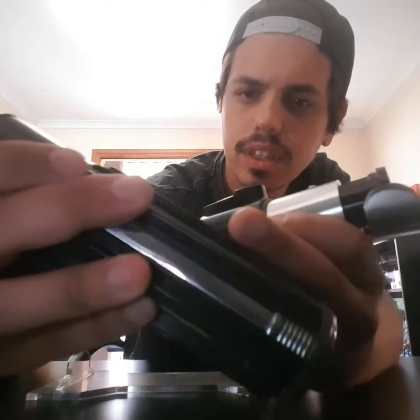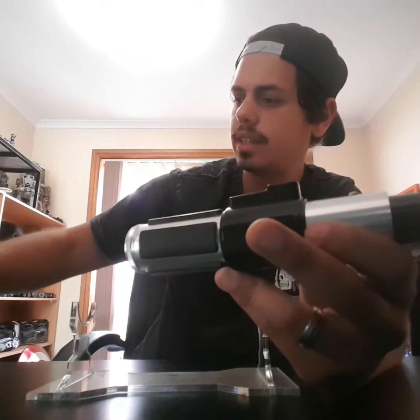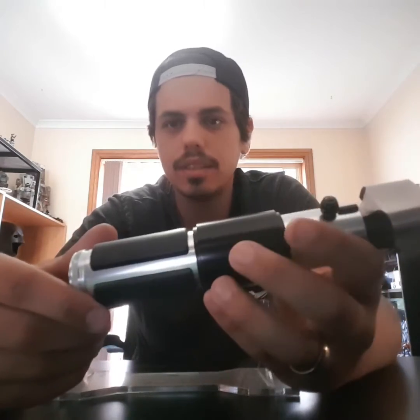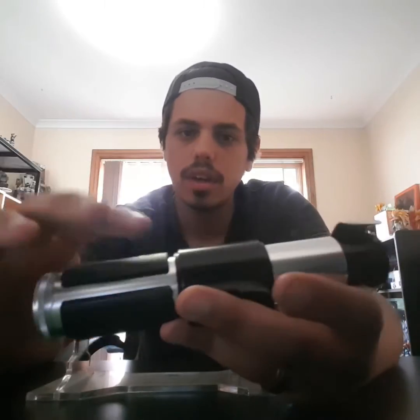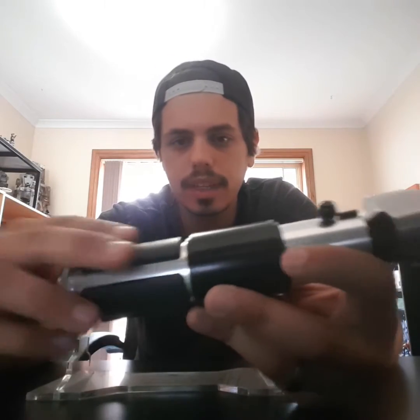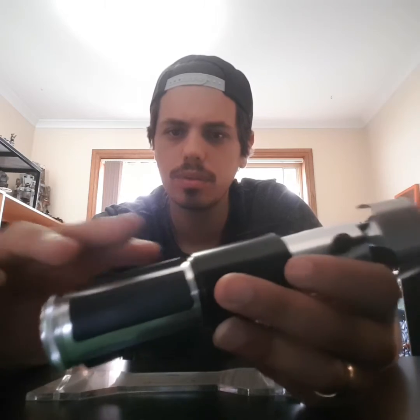You can see a little bit of blemishes from the acetone, because the problem with it is it bites into the actual rubber itself — because it's a chemical. It also does the same with plastic and paint. So if you're going to tackle it, try and mask off any areas you don't want affected, or remove them if you can. I removed everything since it was gutted anyway — removed the clamp and hit it with some acetone. That got rid of the residue off the metal and the grips, and it gave a brushed look where it bit into the rubber.